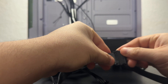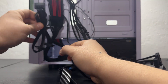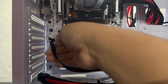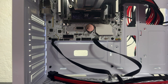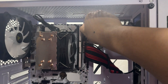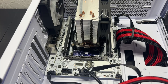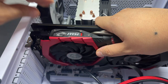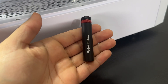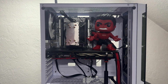First I connected the SATA cable from the PSU to the case cables, then the motherboard extension. I zip-tied the connectors we don't need and connected USB and HD audio. These cables are showing more than usual because this is a micro ATX board in an ATX case. Connected the USB 3.0 cable and the top button connections. The CPU cable originally had an extension but I dropped that to match the other cables. To install the GPU I removed the bracket, popped it in, and added the screws, then put in the GPU extension. There was a lot of GPU sag so I bought a GPU support bracket off Amazon for $7.57 after tax. Added a Funko Pop to match the color scheme.